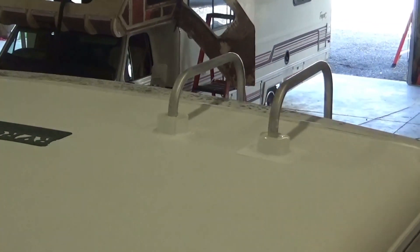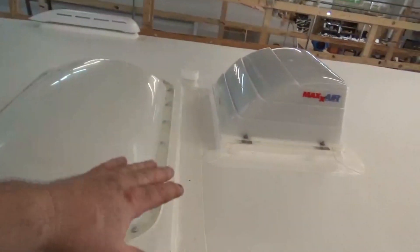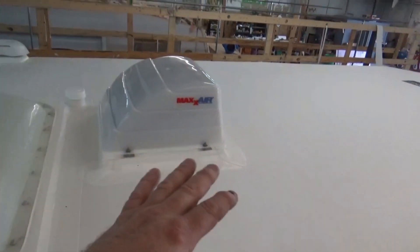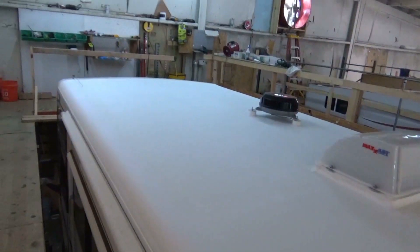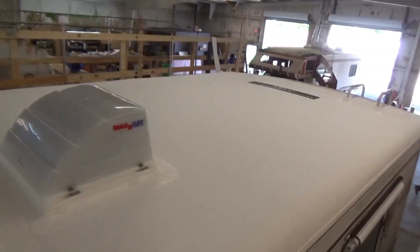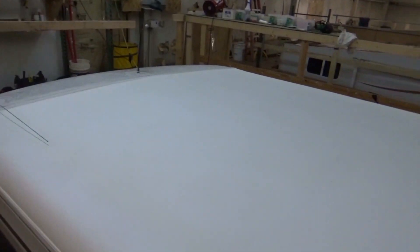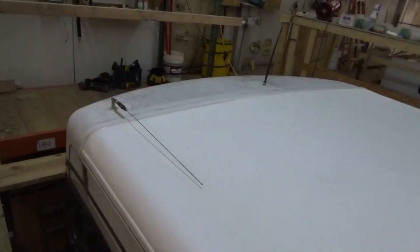That says RVRoofInstall.com and it also has the month and year it was installed so people know how long it's been on here. We've got a nice boot right here for the ladder. We fabricate all of these components here at our shop — I designed all of these; everything here is all my design. You're going to find curbs up on a commercial roof — that's what makes it function. If you don't have curbs, it's not going to function well. This is a 60 mil commercial grade roof, but if I had put this roof down without these curbs, it would leak. You have to have the curbs. We've double-sealed all down here — two layers of sealant.